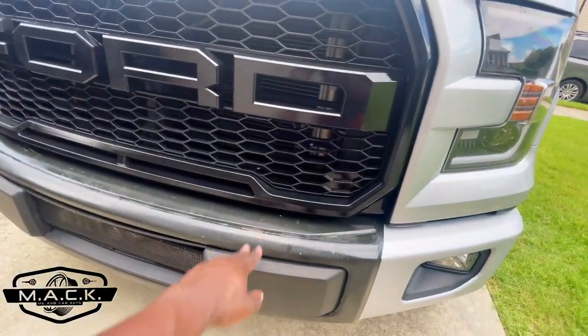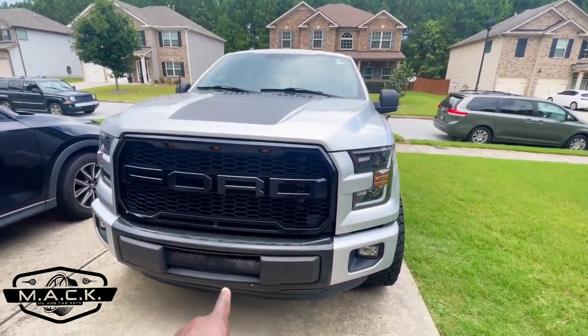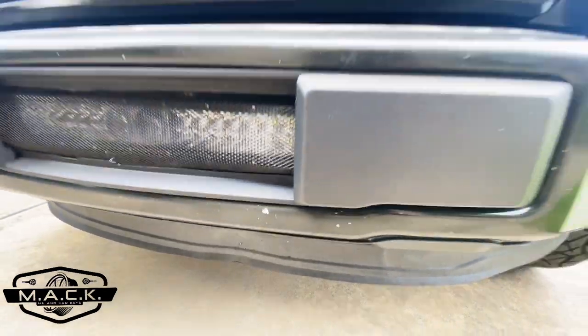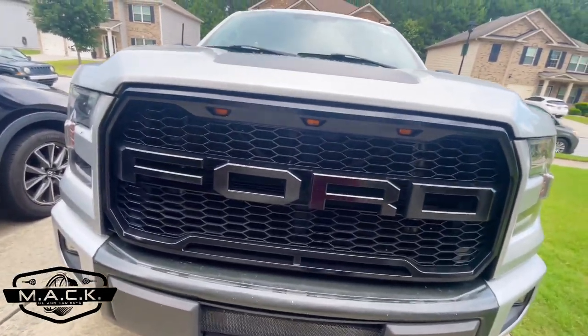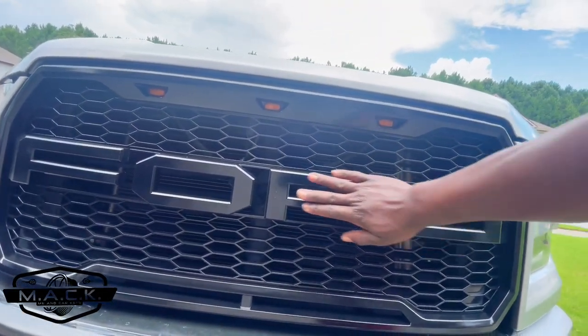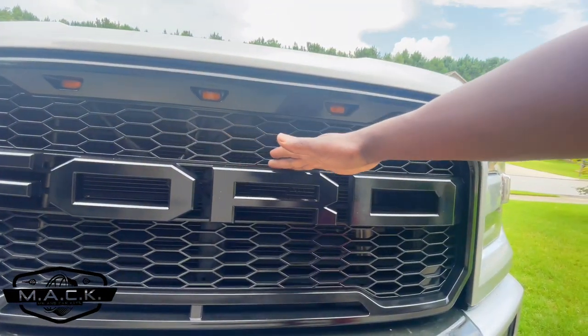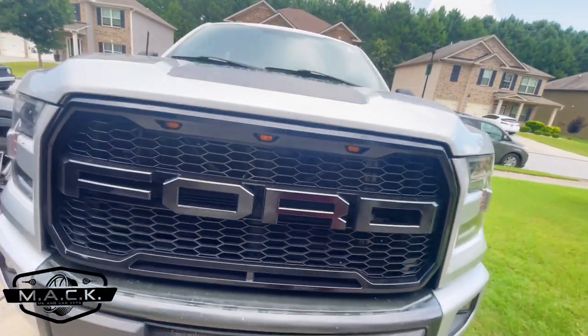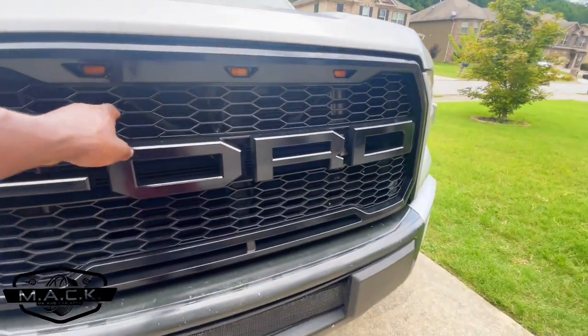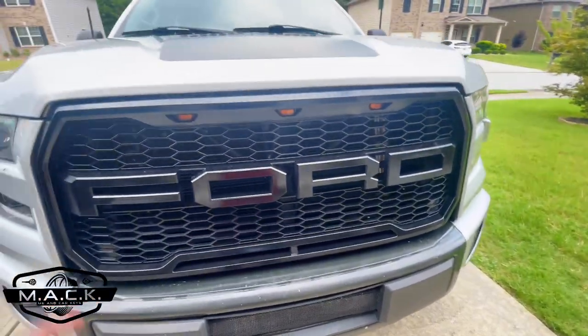The bumper has a lot of little nicks and rock chips in there anyway, so it's about time to get it done. The black I used is an OEM Ford color — I'll put it in the description below. When painting plastics, everything that's flat and facing you looks extremely good, but surfaces on top aren't as good because I put more attention on the front. So if you're painting something like this, make sure you're hitting it at different angles to get everything — especially all these little intricate honeycomb pieces. Make sure you paint at all different angles.